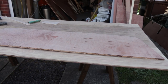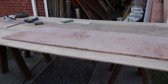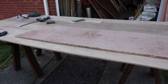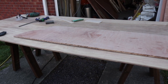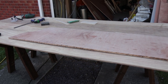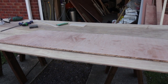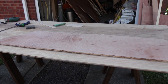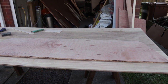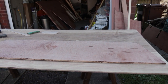So the piece of board is now cut out. You'll notice one side has got a slightly different shape than the other — this is to go around the door slide. So this is our bulkhead and we need to be cutting an opening in the middle of it. First of all we've just got to run a batten along the top of the roof just so that we can secure this up, as one side of the metal is deeper than the other.